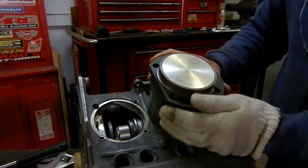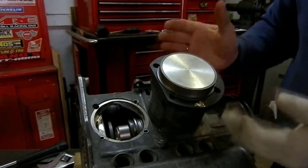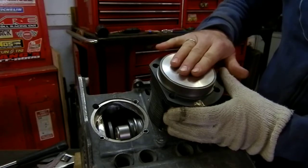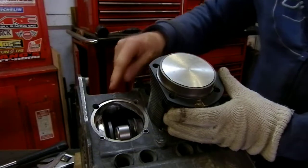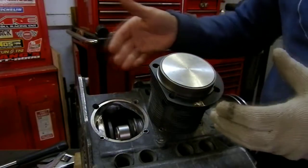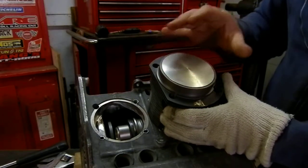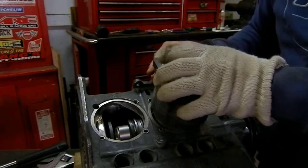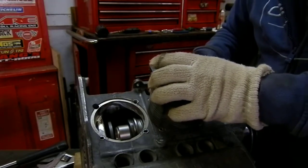You'd probably find that in your build prior to running the engine, because if you're doing assembly, inspection, and measurements, you would find these related problems. I do this stack up because I want to see exactly which one and where I need to make adjustments. The machine shop ended up having to cut this one a little further, which means I'm going to have to use different shims for different barrels. I'd always recommend doing a stack up on each individual deck height to make sure there isn't any variation in the spigot opening where the cylinder sits on the block.